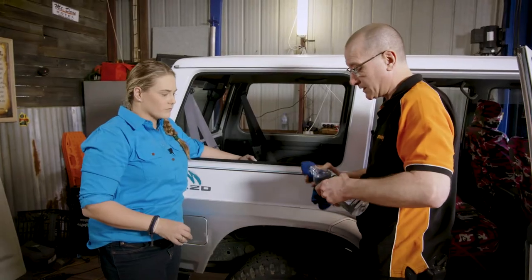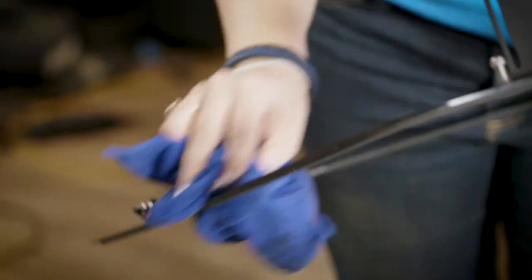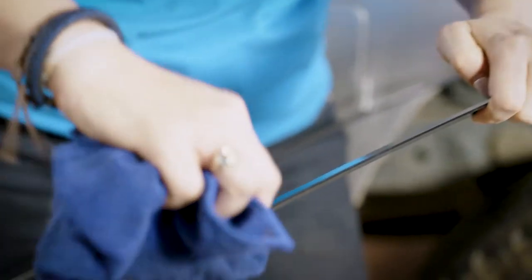So this time we will need to use some wax and grease remover. We're going to do the back of the frame and we're going to do the pinch weld. What's the reason behind it? In preparation for the glue — the next stage is going to be gluing this in place, and we want that glue to stick. So it's really important we do a good job with it.